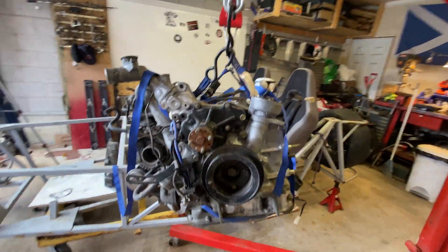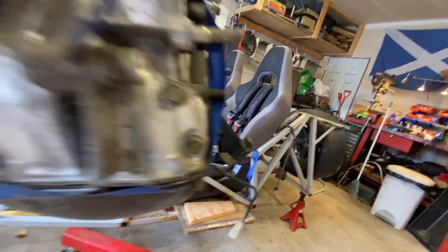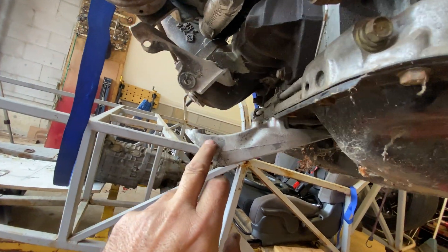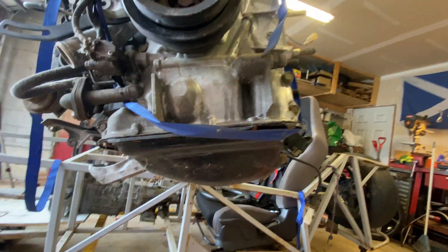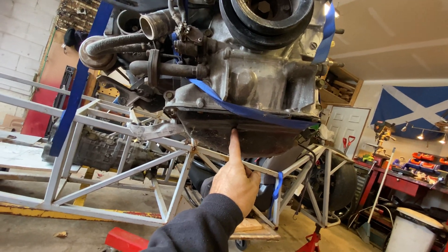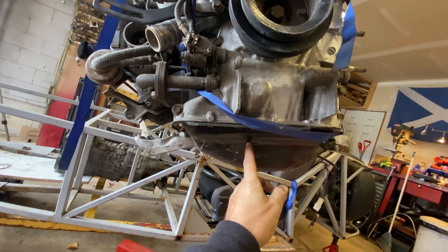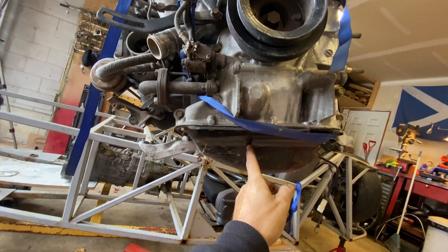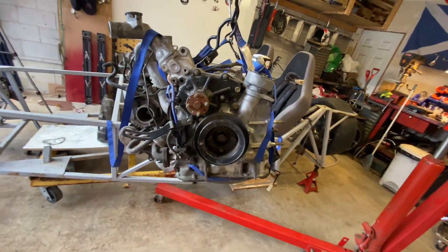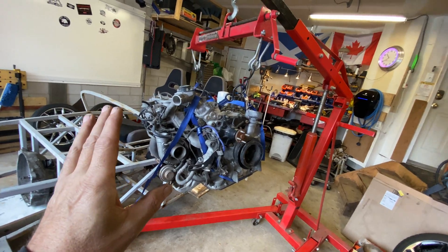Let's have a look at my motor. Isn't it tiny? Just for comparison, there's my hand — it's pretty small. Driver's side engine mount, passenger side engine mount: completely different in every way. That's obviously steel, that's aluminium. This one sticks out half a mile, this one's quite flush. But I think the angle there and the angle there is the same. The centre would be about there, so it doesn't line up. I think it's because it's got this big huge turbo on the left, so it has to balance the weight about there, which is roughly in line with the water pump. I'll look into that before I make any mounts on the actual frame, but it would make sense because that is quite a lot of extra weight.